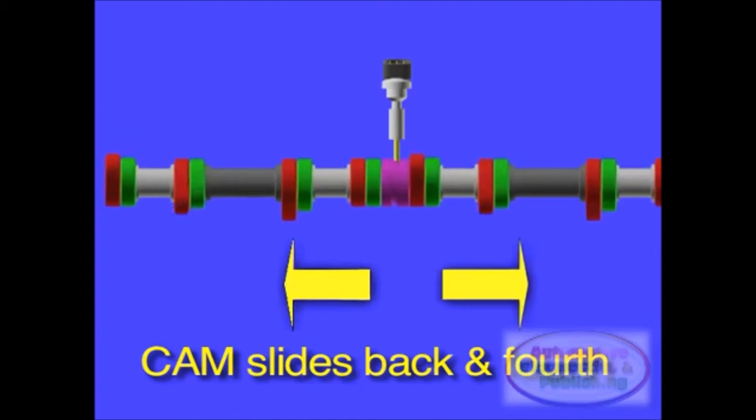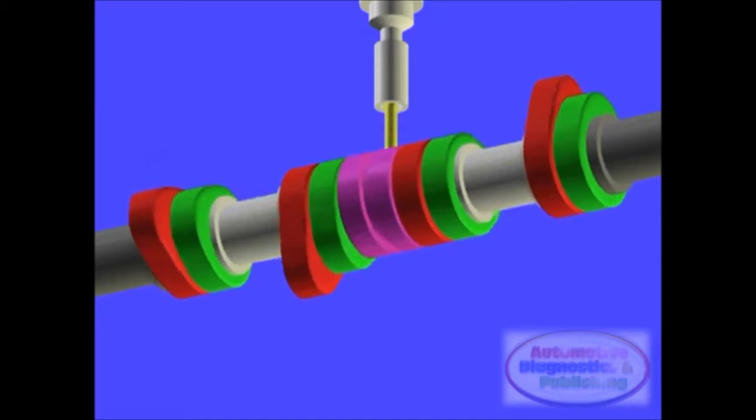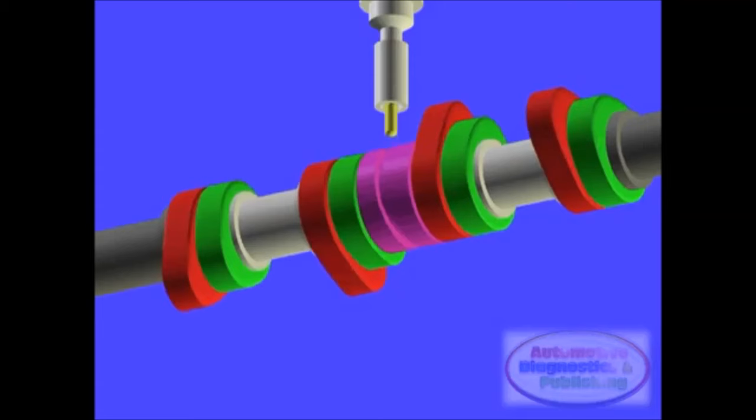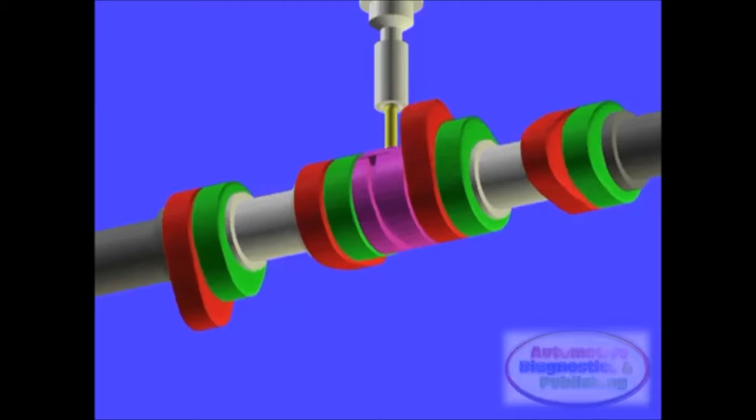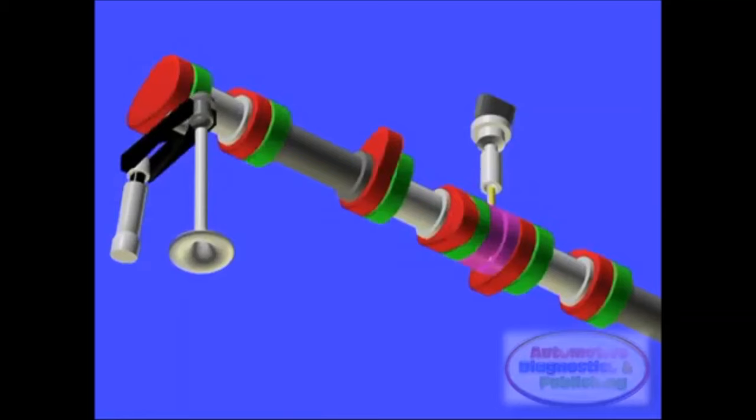The camshaft itself consists of an inner splined carrier shaft, and two hollow cam pieces, each serving two adjacent cylinders. Mercedes-Benz engineers refer to these as cam pieces, of which the first controls the intake valves of cylinders 1 and 2, and the second those of cylinders 3 and 4. Each cam has two cam lift profiles, low and high lift. The cam profile that is engaged depends on the longitudinal slide position of the cam pieces.